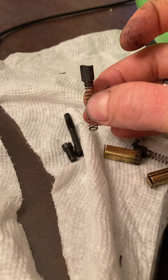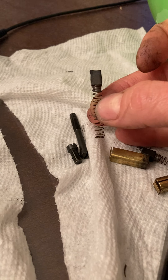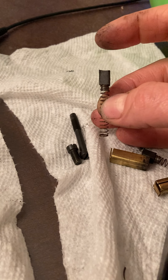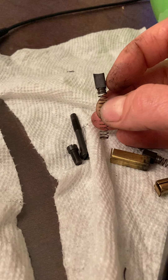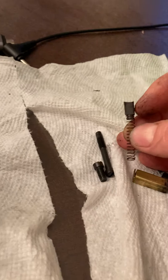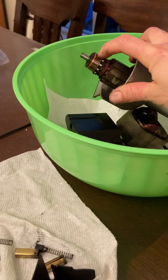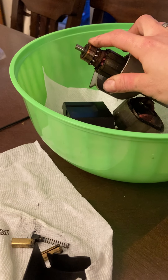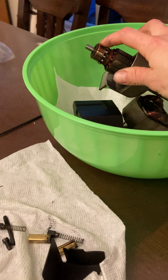So you're not going to get a whole lot of life out of this. Once you start to hit more than 50% through — the carbon brushes are about this big — once you start to hit close to the edge, you're basically destroying this copper right here. And you're going to create a groove in it, which then will require a full replacement of the motor.